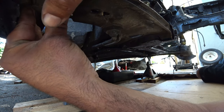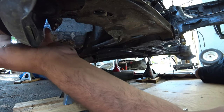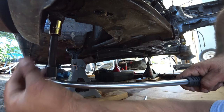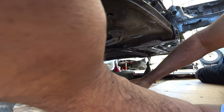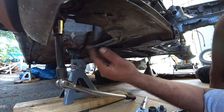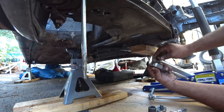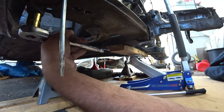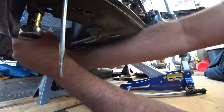It might be difficult without a bolt in here. I'm going to have to get a wrench or a socket in there because it won't let me break it loose without it coming off. I don't have ball joints on here so it makes it a lot more difficult. You'll see the support right here on the subframe — a 2x4 and the jack — because once you drop this, you don't want it to drop too hard on you.